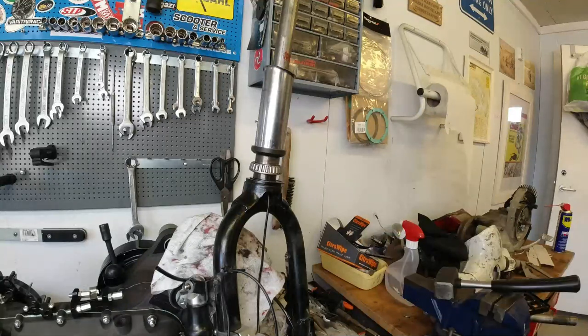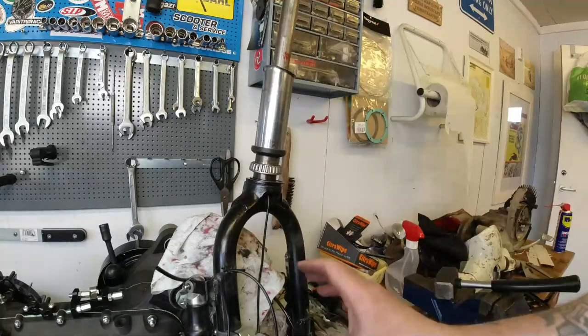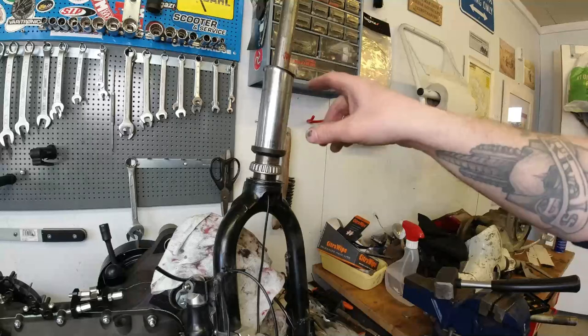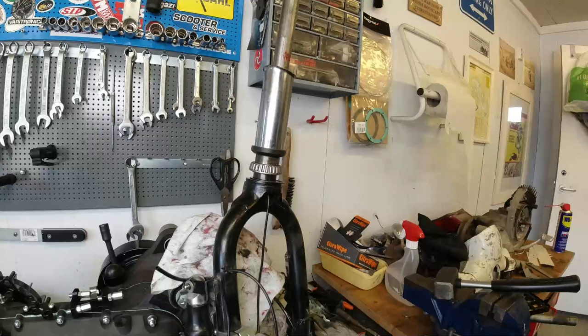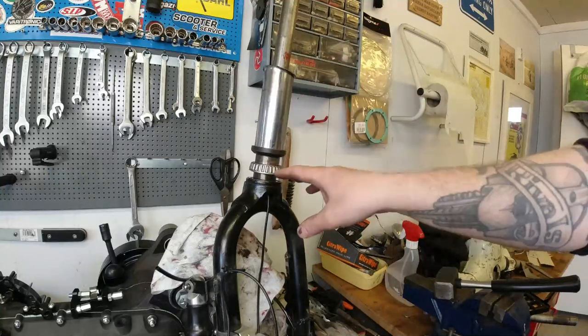I'm just going to have to take all this off and start from scratch and fit the original parts again. That is just so annoying. I'll love you and leave you there and I'm going to go out for a ride. I'm just so frustrated. I normally don't give up — I am not a giver-upper. As soon as you fit the bearing tract on the fork, which is a bit of a pain if your fork is slightly out of tolerance — and this is Innocenti, it's not Rolls-Royce — then the inner bearing race just does not fit on the bearing.